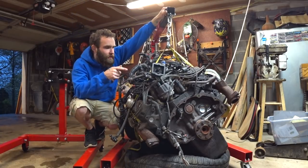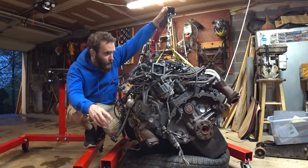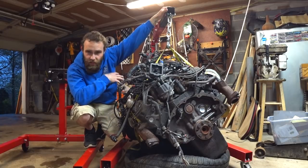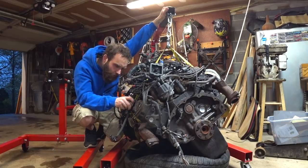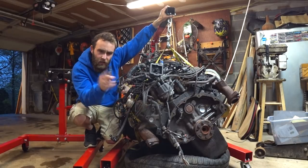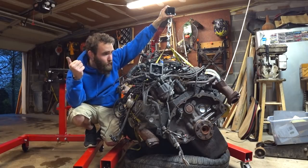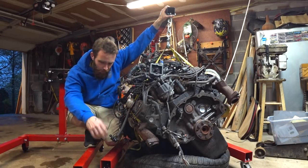What's up, Buck? Doug with Deanie in the Garage. This is the dirty old 5.2 we pulled not too long ago, and it's time to get to work on this thing. The first thing we've got to do is start getting a lot of the fuel injection stuff taken off because we're not going to be using the multi-port. So this whole harness needs to go, the kegger intake needs to go, we'll get the accessories taken off the front, probably get the valve covers taken off so we can get the first peek in there to see how she's looking. And then we're going to get all the degreaser — and I do mean all the degreaser — try to clean this old girl up so that we can paint her. We've got to figure out what color: the obvious answer is hemi orange, but the truck it's going in is Mopar blue. So there are big conversations to be had, but first we've got to get this heavy old cow on the big red over here.